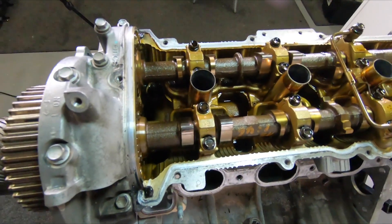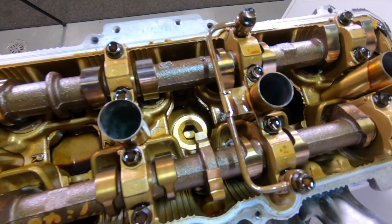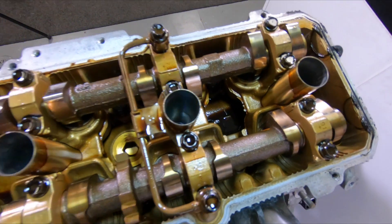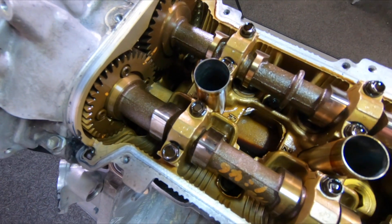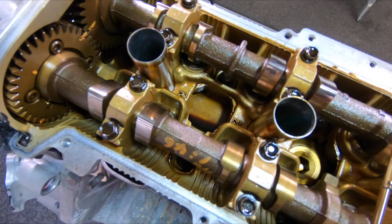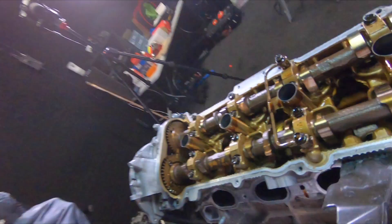Just really unrelated to building the engine - one of the things I always look for when finding a second-hand engine from a wrecking yard is to pull the rocker cover off to get a better idea of the condition inside. You really want to see something like we've got here - that nice honey-glazed colour. That's pretty much indicative that the engine has had a good maintenance history with regular oil changes. If you pull the rocker cover off and it's full of black crud, carbon build-up and deposits, it's not the end of the world but it indicates that engine maybe hasn't had the best maintenance history.